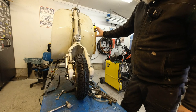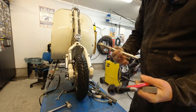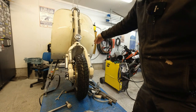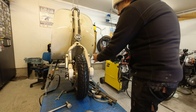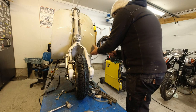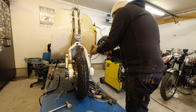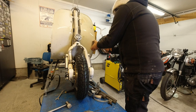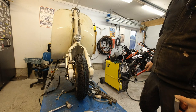Normally if this was a real mess, you can take a vice grip and you can weld on a bit of round bar and a bit of flat bar, and you can actually crimp the corners. But this isn't too bad. The only problem is it was splayed out a bit. I have worked with it so it is pretty straight up here, but I can see there's still a couple of kinks. And then I use this square block of mine — just put it on the backside there and try and get out the kinks. That's looking really nice and straight, actually.